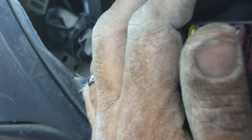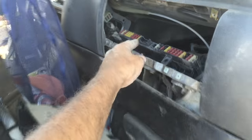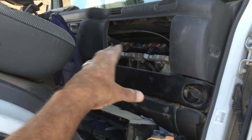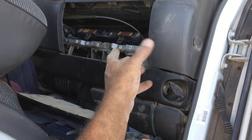A key way to find out is if your instrument panel is down or flickering, because there's some amperage drawn from that fuse. There's a 10-amp, a 10-amp, and a 15-amp — it was the top 10-amp that was blown. You can see it right there, the top one. Whoever made the repair didn't look for that blown 10-amp fuse, or couldn't find it.